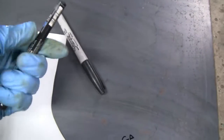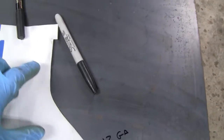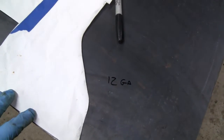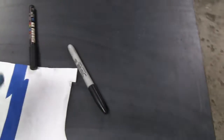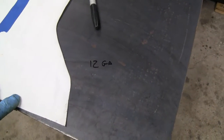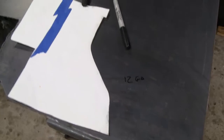You know, the tips here. Well, I was going to open it and show you, but the tips are just so much finer. When you're going to butt weld, you're only using a fine line. You want a small gap, less than a 64th of an inch. And when you make all your tolerances close like that, it makes it a lot easier to weld up.